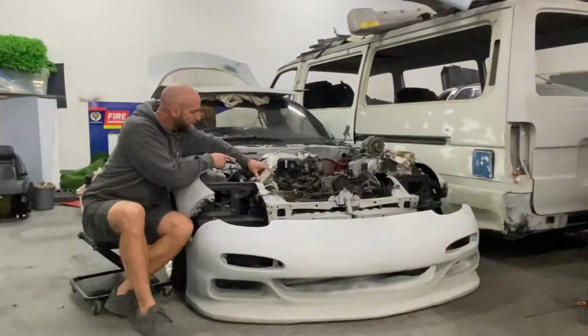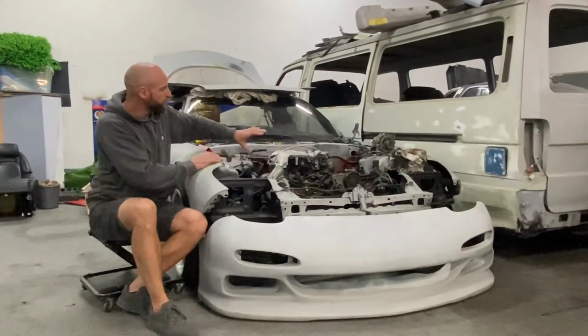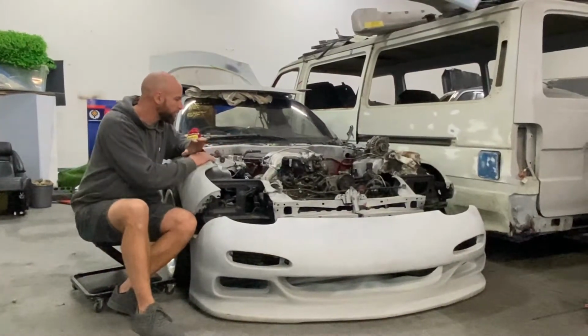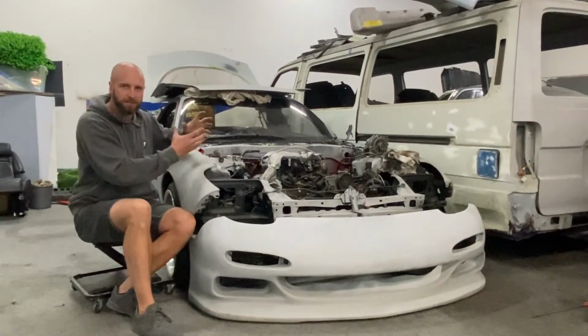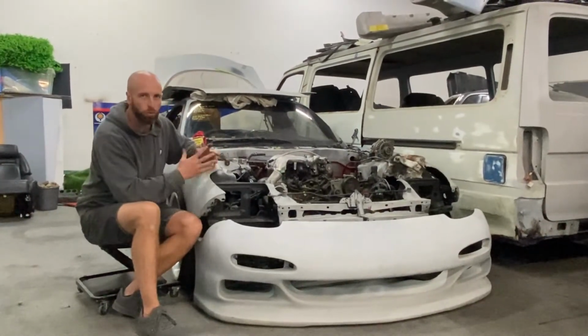So, as I was saying, David's gone ahead and done the oil return for the turbo. So everything's looking pretty good. We've got to do the downpipe to the exhaust and the oil feed still, but it's pretty simple. So we'll go through in the next video and work out what we're going to do with the water pump, power steering, alternator, and how we're going to balance those. We're going to put them back in the factory position, or whether we're going to change it up with the electric water pump and so on.